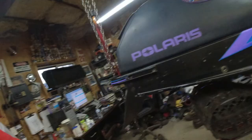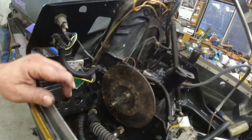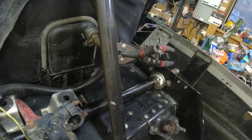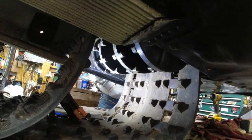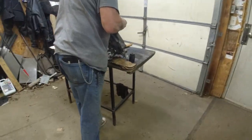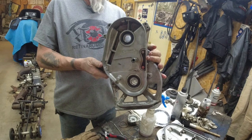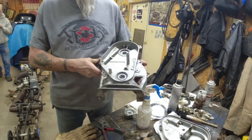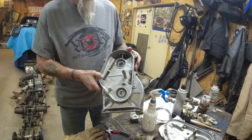We're back again and you can see we got the track in, got the drivers up there, got the jack shaft in, got the bearings on the clutch side on. The reason for that is because it's a four-drive drive shaft — it's got the outer wheels on it and you can't really get that in once you get the chain case in. So Lonnie's got the chain case between him and Dennis; it's spotless, and we just wrestle it around the cooling hoses, and then once it's on the sled we start building it up.